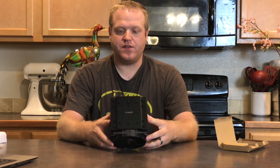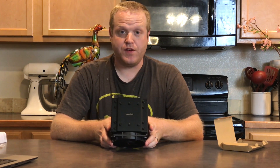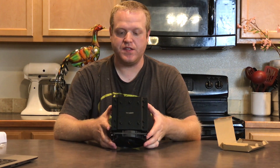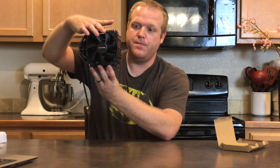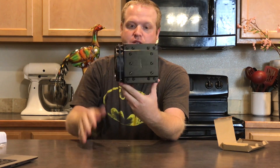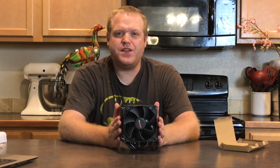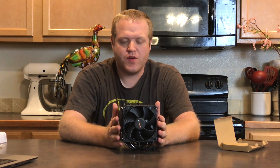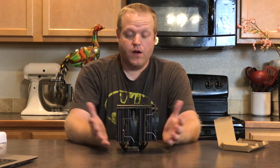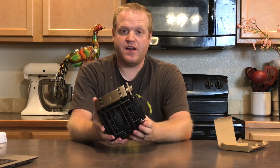The top, as mentioned earlier, is brushed aluminum, and it looks great. This is what you're going to be seeing on most cases with a vertical mount motherboard, and I have absolutely no complaints with that. Noise levels you can expect at the 50%, 75%, and 100% PWM marks are 13.2, 19.5, and 26.1 decibels respectively. Overall, it is a solid design — it looks really good, and I can't say enough about how good it looks.